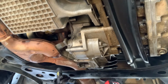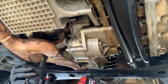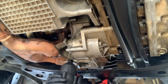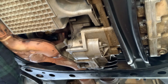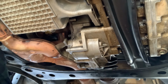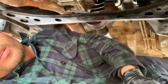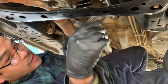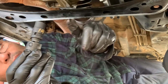Okay, here I'm tightening the rear exhaust manifold bolt. And then I'm just setting number 1 for this torque wrench. Then I will torque it down to 30 foot-pounds. So both of these, the front, and then for the flange one with the flex pipe, I'm using a swivel adapter like this. It's a 14mm as well.